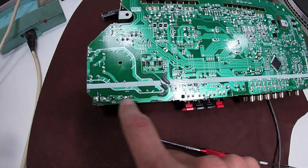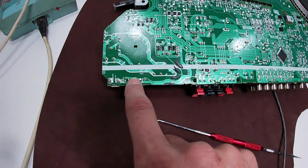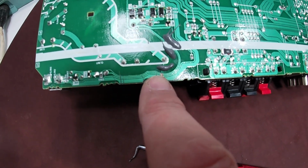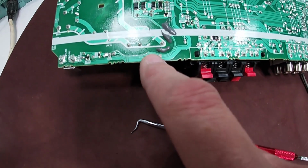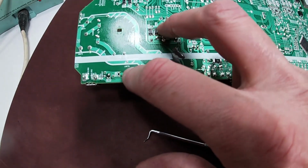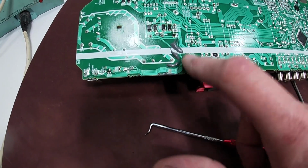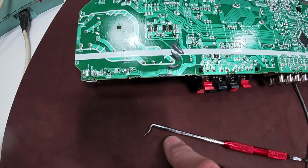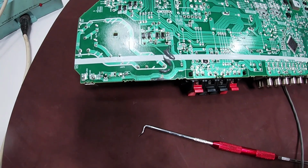Testing from the circuitry here up to here, where it lands, there is no continuity. But if I test from here to the point where I've etched it off, essentially, there is. So we'll bridge these gaps with some solder, and hopefully when we test here and here, we get continuity. And we will have to test any variation to make sure that the solder didn't actually jump the line as well. This is going to be incredibly difficult. So we'll see how it works out.